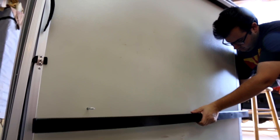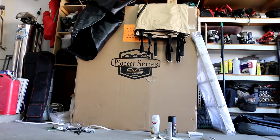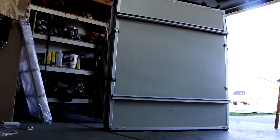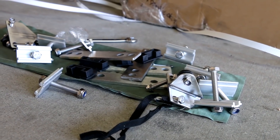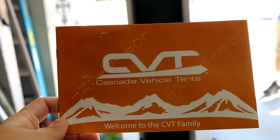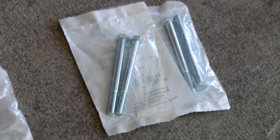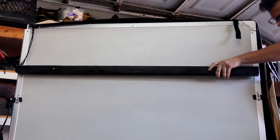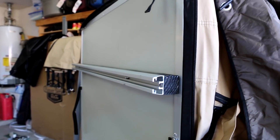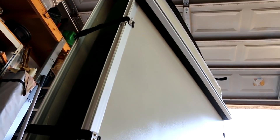Now that our new wooden spacers were ready and the aluminum rails were cut, it was time to start assembling the tent rails. The tent is a CVT Mount Shasta Standard — a two person tent, and we'll be going into tons more detail when we take it out on future trips. The tent comes with a variety of mounting hardware and instructions, however since we were adding a non-factory wooden spacer, we needed to use longer bolts to hold everything together. The bolts go down through the top of the tent floor, come out the bottom, go through the wood spacer, and then into the aluminum rails, held by a nut secured inside the rail itself. We tightened things up, tested the strength, and everything was nice and firmly mounted, so our addition of a couple of inches of wood would have no adverse effects.